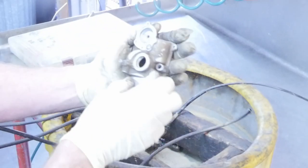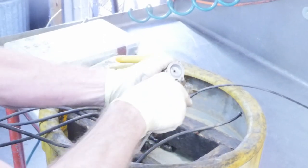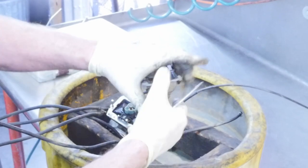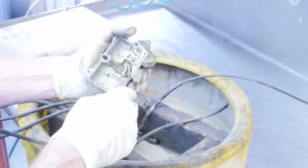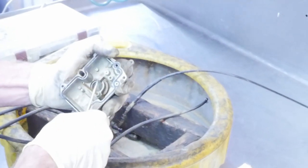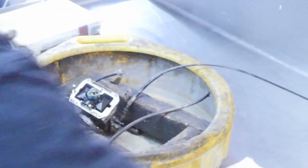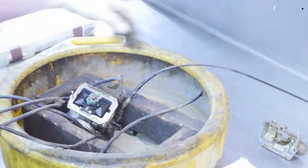Not too bad — we'll be soda blasting all that. You want to get everything off the float bowl that you can. Get all screws out of it, all O-rings out of it. Just have your float bowl. Don't take out the brass jet — that can stay in there. We're going to test it to be cleaned later. Everything I'm going to clean, I'm going to keep aside.